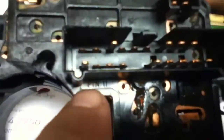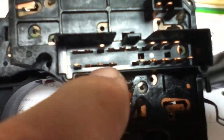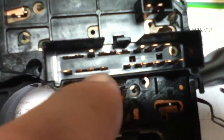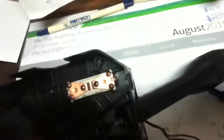Closing the circuit activates pins 13 and 14 — these two pins right here — and that will turn on your lights. With everything assembled, pin 1 is up here and pin 11 is down here, then 12, 13, 14. If you have a multimeter with a continuity tester — some people call it ringing out the circuit — clip your leads to those two pins and pull the switch out; it should beep or show no resistance.